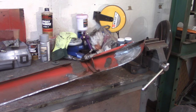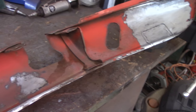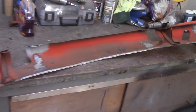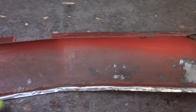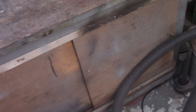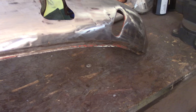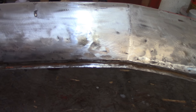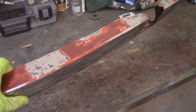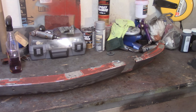All right, about 10 after 8, calling it a night. No work on the bonnet tonight, but I did get work on this front valance. I brushed it all down and cleaned it up a little — it looks a little bit better. This is essentially all surface rust that I'll have to take down to bare metal to get all that roughness out. I got these areas cleaned up where the brackets are going to go and got them essentially ready for epoxy primer with a paintbrush. Then I started working the dings and dents — you can see all the high spots and low spots down there. It's a hot mess, and this thing is incredibly awkward to work with since it's bent, curved, and all sorts of complicated stuff.